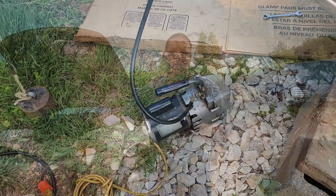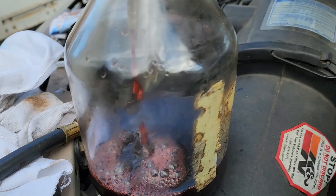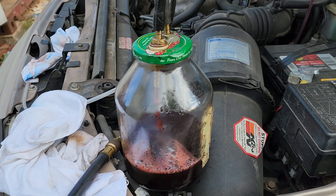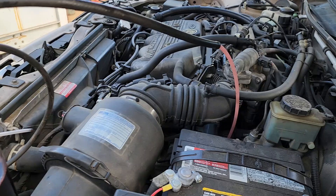Here's the setup we have going on: vacuum pump into this reservoir here. You can see it's pulling all the transmission fluid out. I've got a dip tube shoved down into the dipstick tube right there. We're just pulling all this out — it'll probably take three jar-fulls or so, and then we'll crack the transmission pan off and see how much comes out from that.